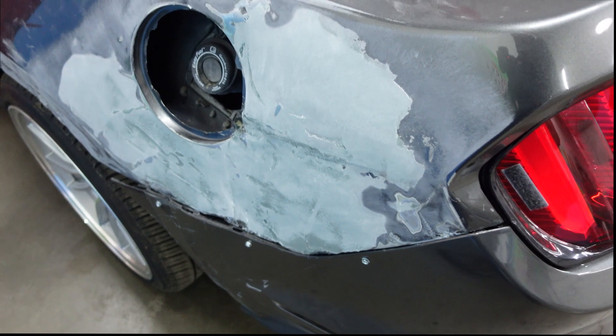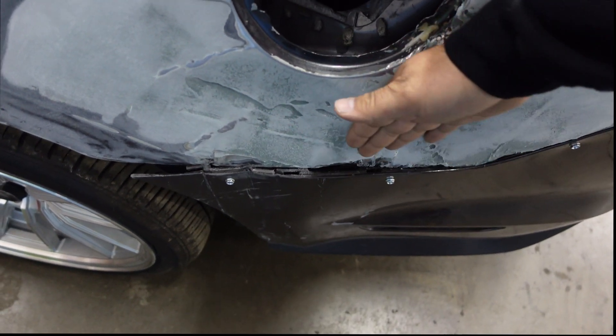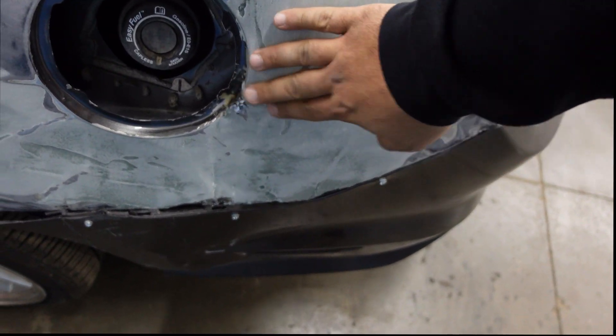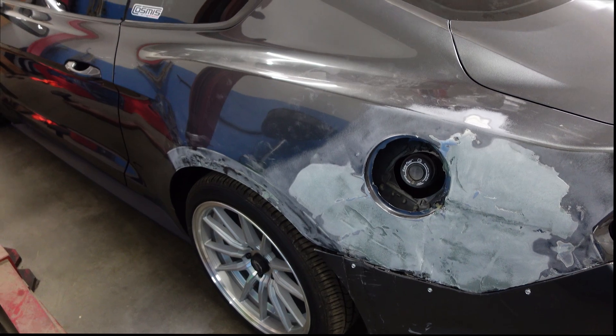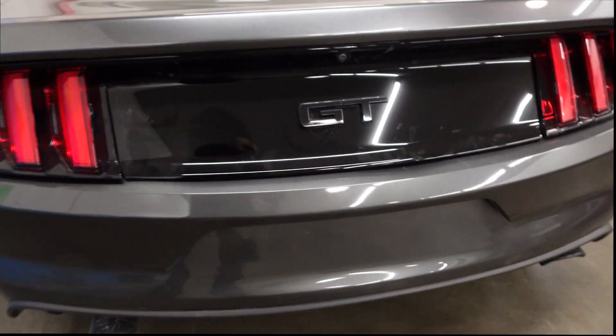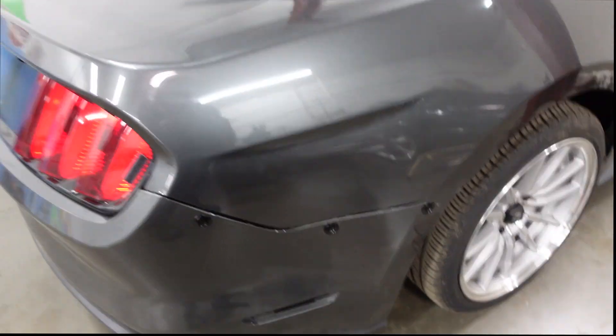So this is where the car stands right now. We got some of the body work here being started — Riley got it mudded and got it somewhat sanded. We've got to just bring the body lines back into it. He's not done, we're just starting to get the mud on it now. You can see this all needs to get brought out more right here — we're going to bring this line out a little more, but it's getting there. He's going to prime it, spray it, and then fade the clear in. The bumper's on now and I've got quick release tabs all across the side.